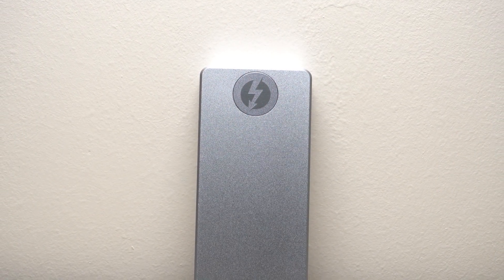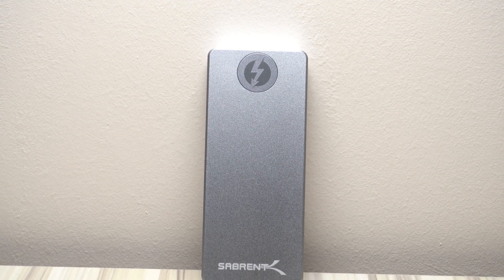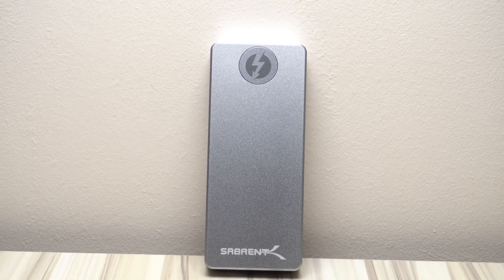While those first two options are plenty fast for most people, one benefit of the M1 Macs is two Thunderbolt ports. Apple adopted Thunderbolt early and will likely include it for a long time, especially since USB 4 now incorporates the Thunderbolt 3 standard — making it a pretty future-proof choice. Thunderbolt 3 caps out at 40Gbps, and I've been seeing read and write speeds of over 1,000MB/s. This Sabrent Thunderbolt 3 enclosure is similar to the USB one but more expensive at $79.99. Paired with the Rocket NVMe drive you're looking at about £175, which is still less than Apple charges for a 1TB upgrade.